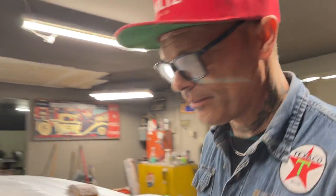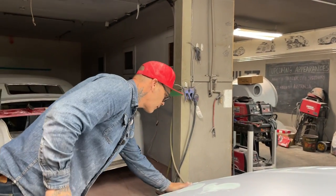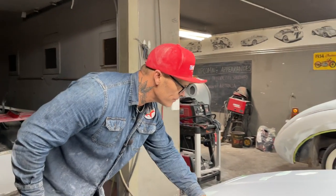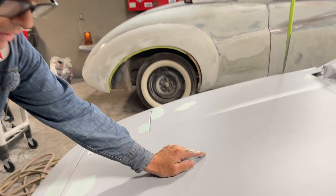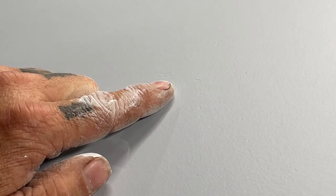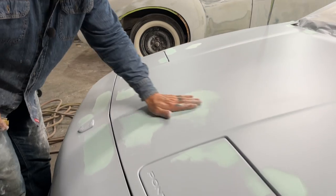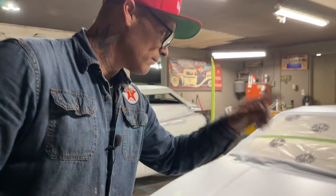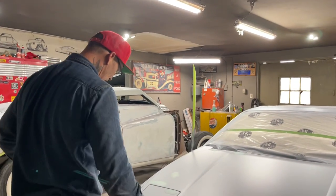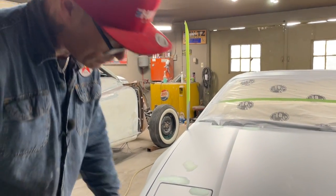They're still damp. We've got a wet day out, so. With these ones on the hood, I see I got a few more scratches up there. If you want to come take a look, sweetheart. It's not scratches, it's where it's checked. It's quite something else. So I'll have to put a little filler in that. We'll do that a little bit more. Basically, the ones on the hood, I'll probably end up doing with just the DA, just hold it flat, nice and easy.